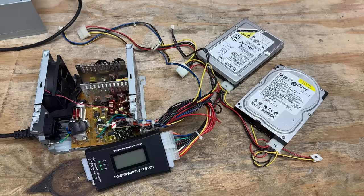Moving on to the power supply - it's a bit of a weird one. It has standard ATX mounting holes but it's ultra-compact in one dimension. I don't know if that's some kind of standard, but I don't have anything to replace it with, so let's hope it's good. And that's an immediate failure - it's acting like it's shorted. I wonder what's wrong. Wouldn't have anything to do with all that capacitor plague going on? Yeah, this thing's completely plagued out. But at least that means we can recap it. For right now I'm going to have to use a surrogate power supply.